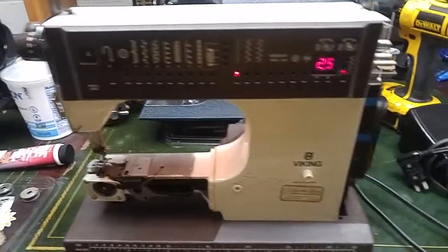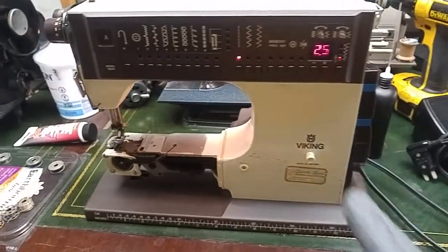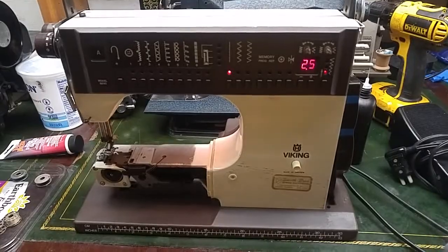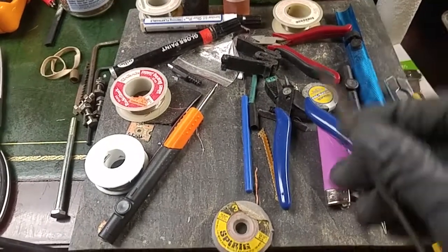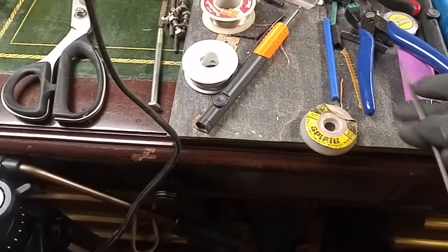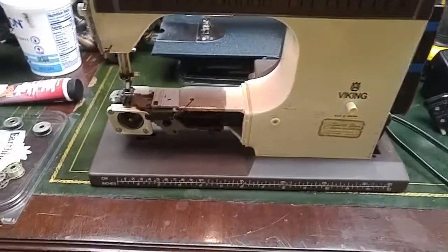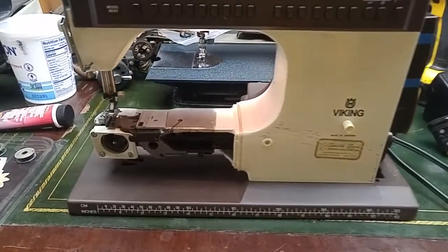I got her all lubricated — I used tri-flow. I didn't put grease in the bearings though, just used the oil for now. Running with the chuck just to make sure everything was nice and loose. I used this little file very carefully along the commutator, super lightly, because I didn't want other particulates. I vacuumed that out and went in with a q-tip just to double check, making sure there are no fibers from the q-tip left.